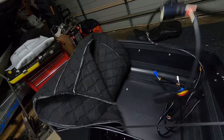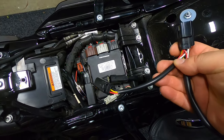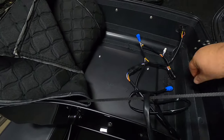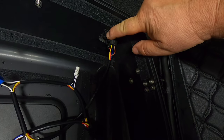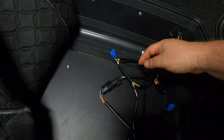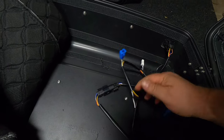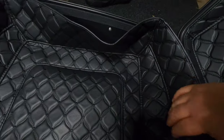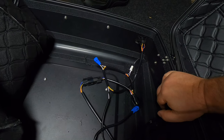The pack comes with this wiring loom. You've got two bits that obviously plug in here — daisy chain them along like that. On the other end you've got a grommet halfway which goes into your hole, so you feed that in. Then you've got this plug here with a little locking latch — that plugs onto your light system. The extra connectors are for additional lighting like tail lights, indicators, and all sorts of other lighting you can plug into these extra plugs. I'm going to zip tie them up and put them under the liner out of the way.